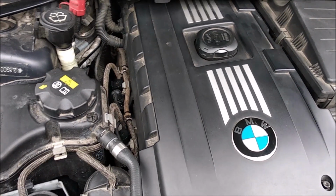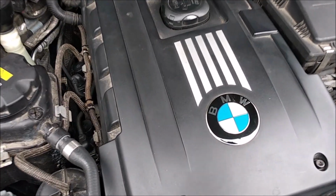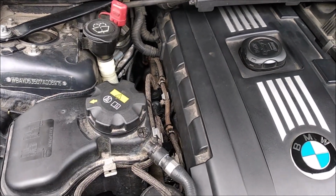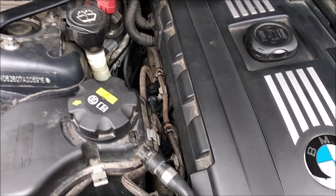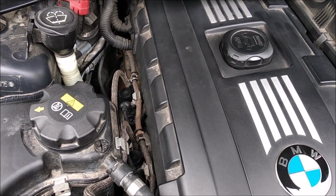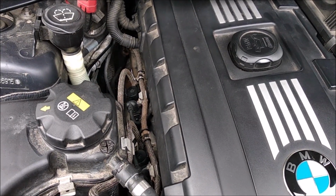So I kind of knew that my oil burning was related to the turbos, because it was smoking badly when I was idling to a stop, and there was no smoke when accelerating. So I was about to give it to the shop to rebuild my turbos, but then I came across MHD tune and decided to flash the car, see how it goes with the tune.